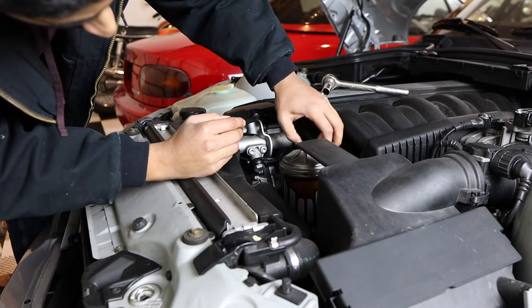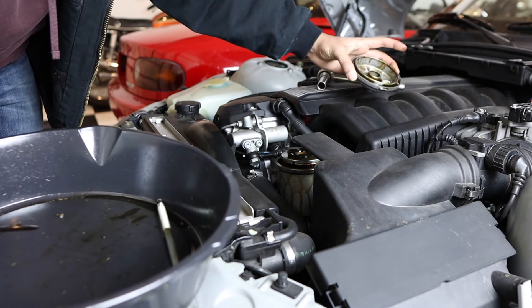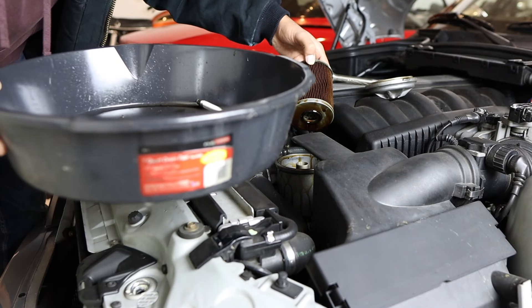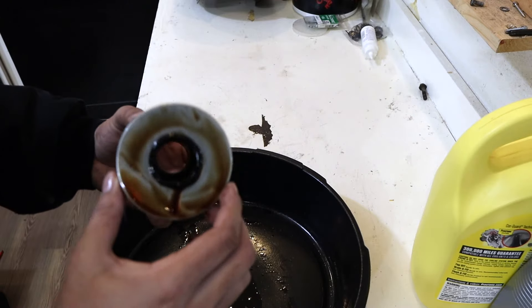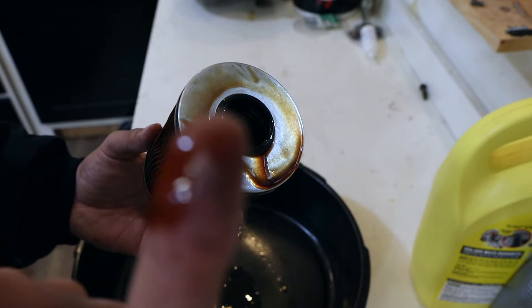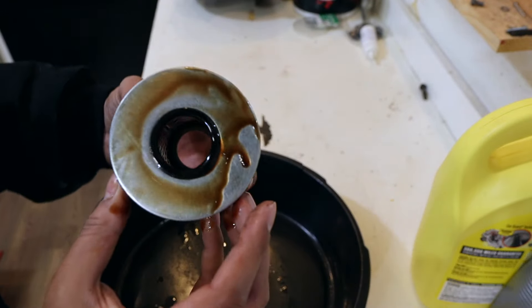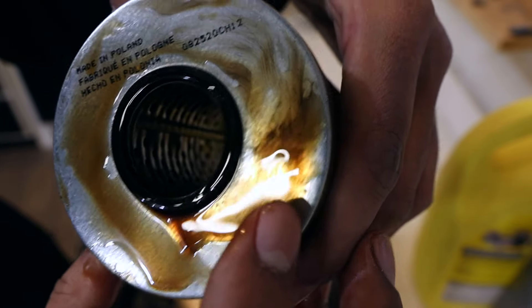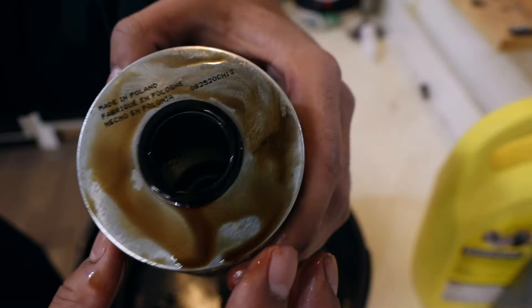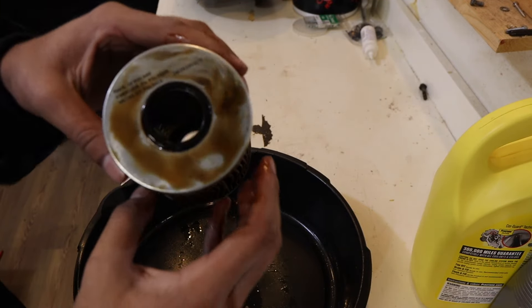It's been about a year and it's beautiful. There's going to be oil around the filter — the smartest idea would be to take this bolt out first. That is a long bolt. Now I have access to the filter. Taking a look at what we've got here, the oil looks pretty clean. It does look a little old, but it doesn't look like water has entered this whatsoever. With the little bit of smoke we have, I would expect there to be a visible sign that there was water in here at some point. There's something that almost looks like a water streak, but it looks clean — which is a peace of mind that I'm very happy about.